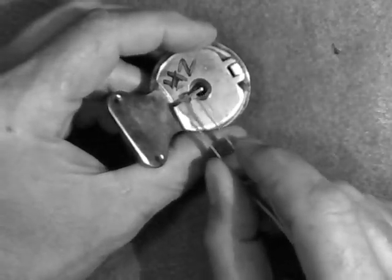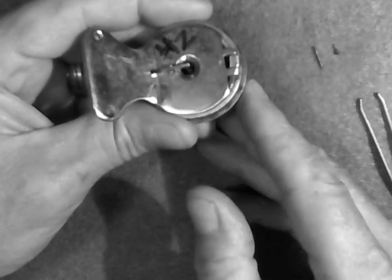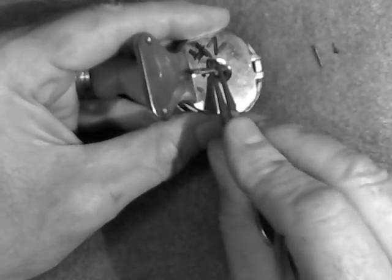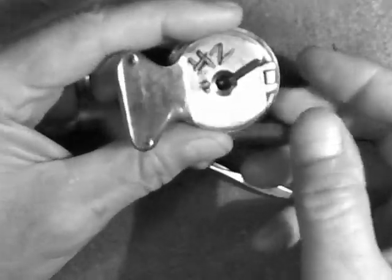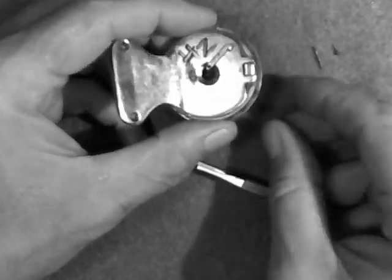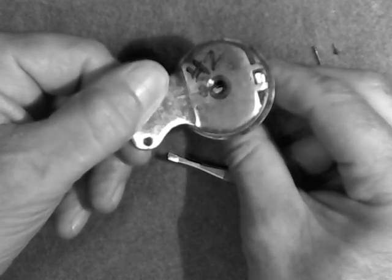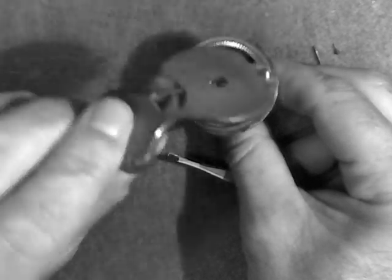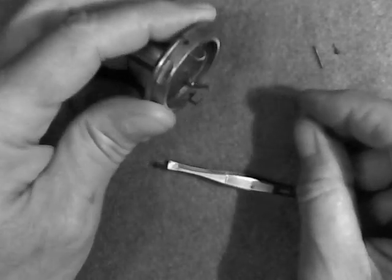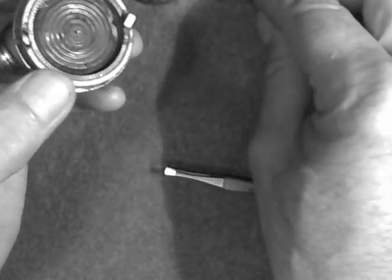We've removed the pin for the stylus. Now we're going to remove the pin for the hinge. Nothing's changed — we haven't tried to move anything at all. Now with a small pair of tweezers or with your fingers, just lift up on the stylus, pull it out of its cutout, and just let it flop there. We've got a limit pin on this side — a lot of directions tell you to remove that limit pin, but you don't need to. All you need to do is lift up on the back of the reproducer on the tail weight. It'll come up off of the hinge, the stylus falls through the hole. Pull the pin out of the limit loop and you have removed the tail weight. Now to remove the stylus itself — notice it's hanging by a link. You simply unhook it from the diaphragm and set it aside.